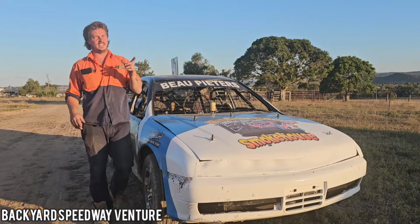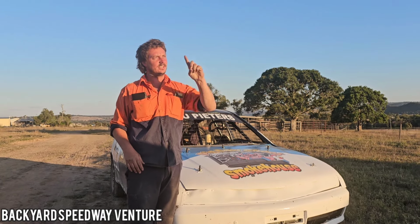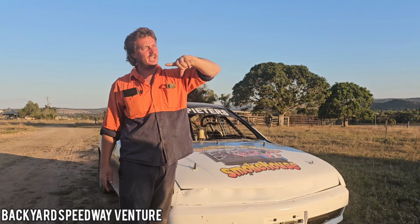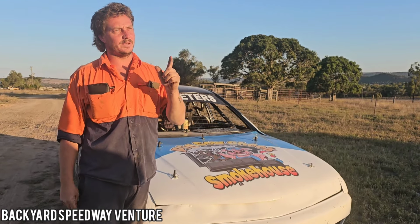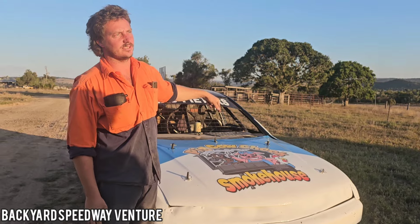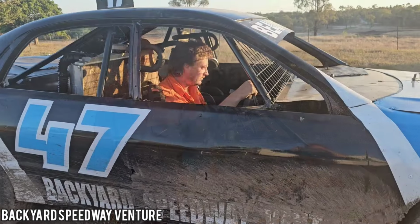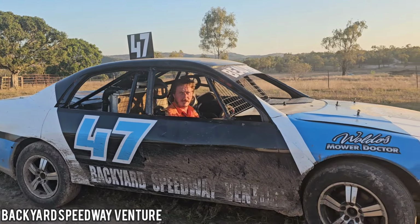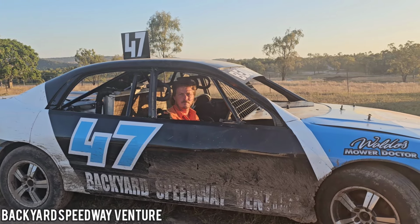It doesn't have a neat idle, like the fuel ratio gauge is driving like this. It's going up from about 11 over to 15 and then back and then like that. It hasn't got a neat idle, and I think that's because it doesn't have the O2 sensor plugged in. I think if it has an O2 sensor plugged in, that'll even the idle out. Right. I can't blow the cunt up. It already sounds fucked.